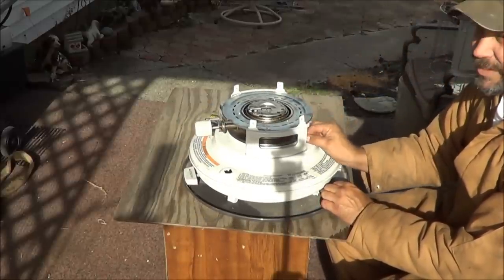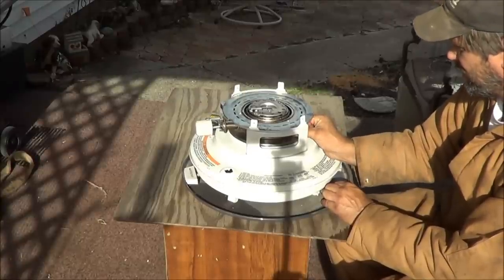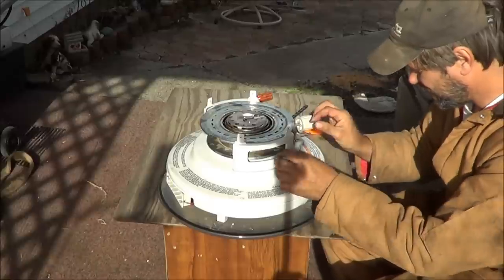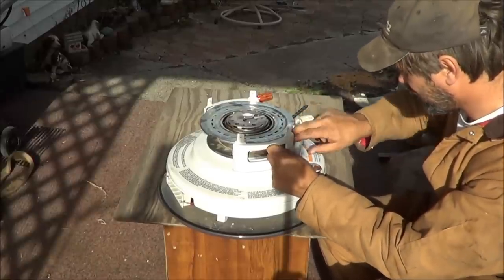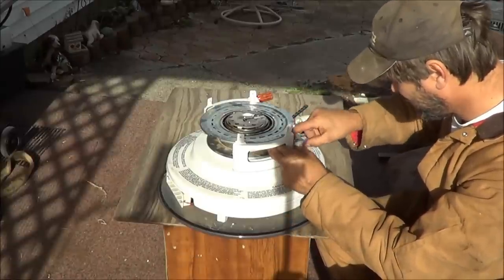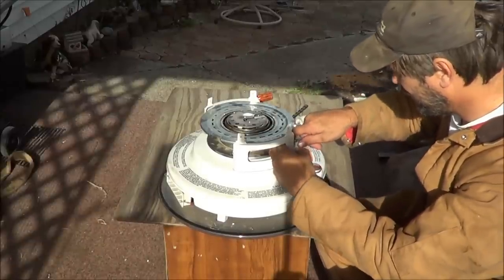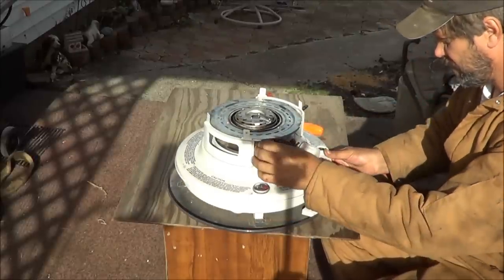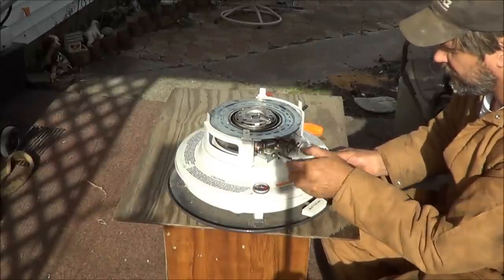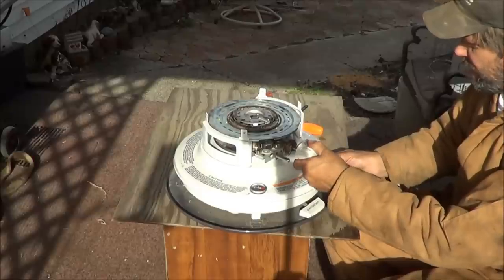Once you've done it once on your heater, it's not really that big of a deal. This one's a fairly new heater — I just wanted to show you how to take the wick out. The older kerosene heater designs seem to be a little more user friendly. Now that's your tip-over weight — so if that gets knocked over, it releases this latch, and that's what kicks the wick back down in. That's what you want — you want it to kick back in.